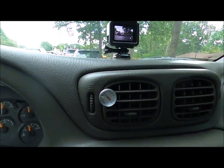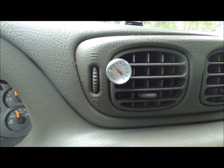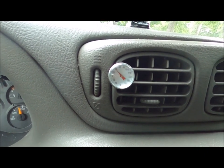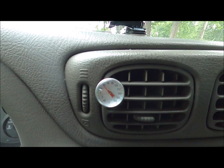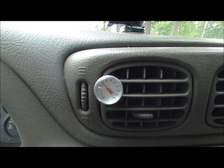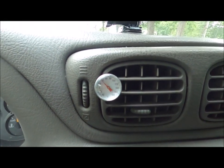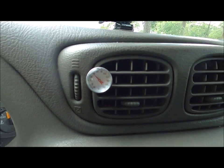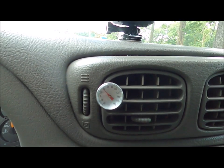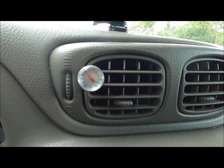I've been meaning to bring this thermometer home to show you all how cold my AC gets in my Trailblazer. I dumped the AC out about eight years ago because I wanted to replace the harmonic balancer. I did not vacuum the system down — all I did was put freon back in it.